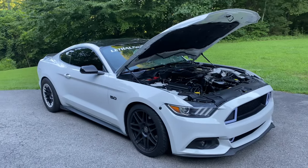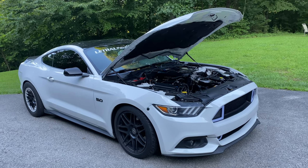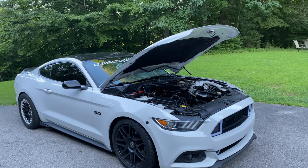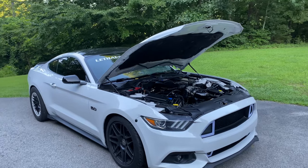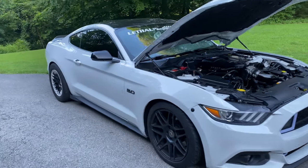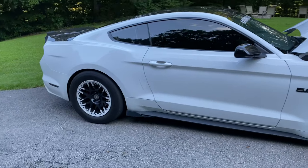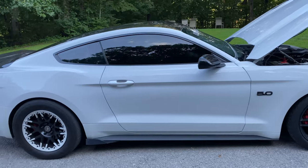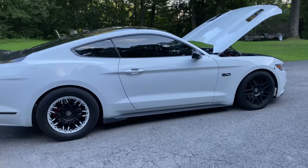I have built it over the past several years into what it is now. And to be honest with you guys, it's been low four, 60 to 130. It's trapped over 150 miles an hour on stock bottom end. So it's in the medium echelon of being a pretty quick car. I'm waiting on axles from G-Force. Been waiting 4 months. Hope to God they send them soon. When those come in, I'm going to throw a trans brake and a two-step setup on the car so we can leave off the line under boost, and that should significantly improve track times.